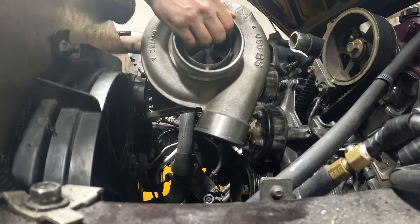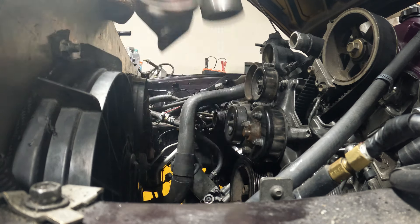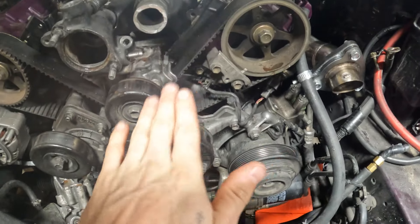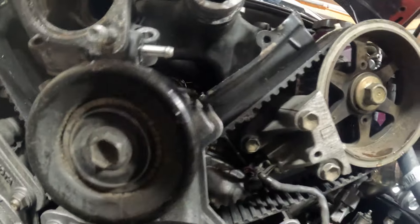I want the placement about right there — the angle isn't the best but it's the best I can do for now. I need to almost build a bracket to hold the turbo where I want it to sit. The turbo is sitting about right up here height-wise and that's right where this hose is coming out, and I still have that nipple hanging out the bottom that went to the oil cooler. Tilting it up would probably work because I need to go up and over the turbo anyways.